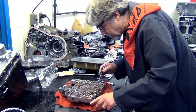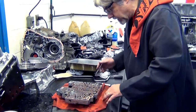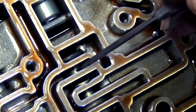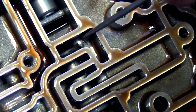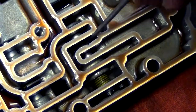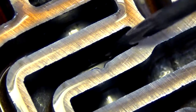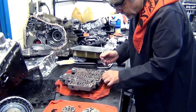Here's something interesting — it looks like our overdrive servo regulator valve may be stuck towards the bore plug. This valve is supposed to be seated back here. You can see the valve here clearly, but there's no valve on this side. I believe we may have found why we have no overdrive. It looks like there's something in there — let's see if we can remove this plug.